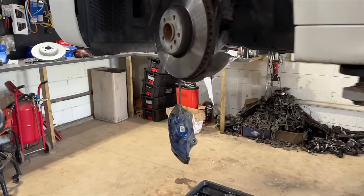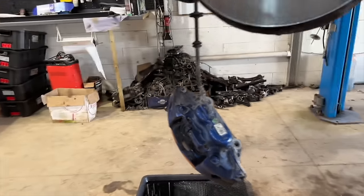So it's not just replacing the mechanical parts, because the DSC ECU, the ECU that's responsible for the stability of the car, the one that's actually pressing the brakes, will apply different pressure on those brakes. That's why coding is also needed if you install those and they did not come with the vehicle from the factory. And as usual, some things can go really, really wrong.